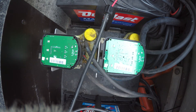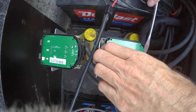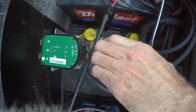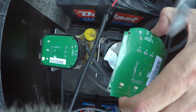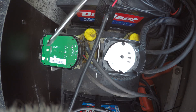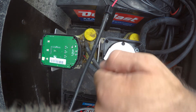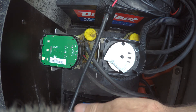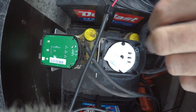Let's turn it off and turn off the power — I want to see something. Y'all hear that noise it makes, that doo-doo-doo-doo? I want to see if that was just this one making that noise. Turn the power back on. Yep. So when it doesn't make that startup noise, the motherboard's bad. If you only have one unit and it's not making that noise when you turn the power on, then it's bad. Motherboard's bad, pump's fine.